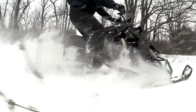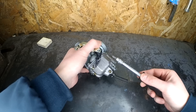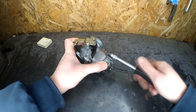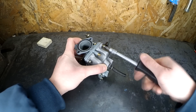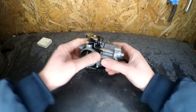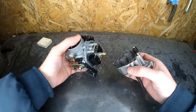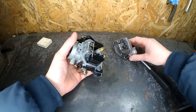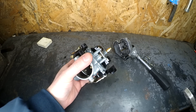Unfortunately our snowmobile didn't go anywhere. Well — the engine with this carburetor started on the first try and confidently held idle, but absolutely could not build RPM under load. The cause was the main fuel jet having insufficient flow — it severely leaned the mixture, and needle adjustment did nothing to solve the problem.